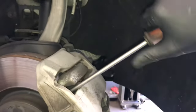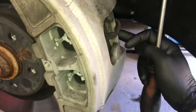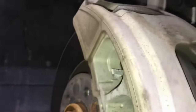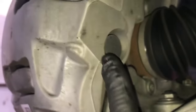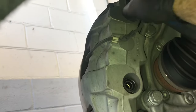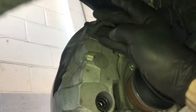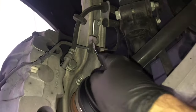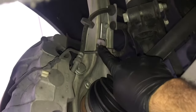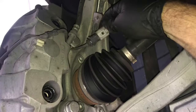I'll do this on top and bottom to get the pistons to push in just a little bit. A lip develops on the rotor, and if you don't push the pistons in first, the caliper won't come off when you pull it. Now on the back side of the caliper there are little plastic dust caps — remove those with a plastic screwdriver, one on the bottom and one a little further up. Then unplug the brake wear lining sensor by unhooking it from the caliper, slightly flaring the tab, twisting it counterclockwise, pushing downwards, and then squeezing the tab to pull the connector apart.